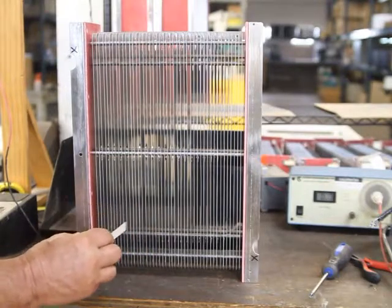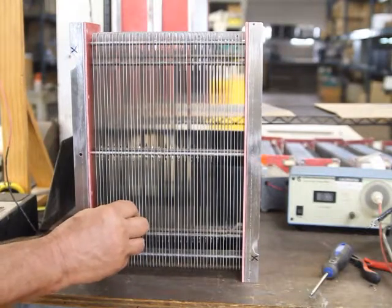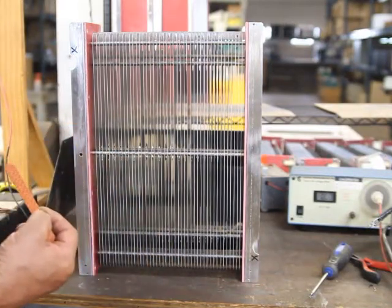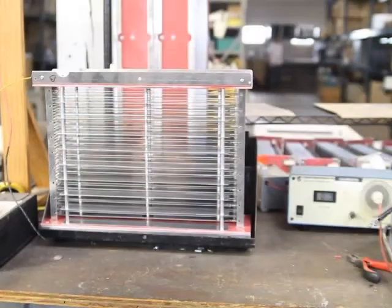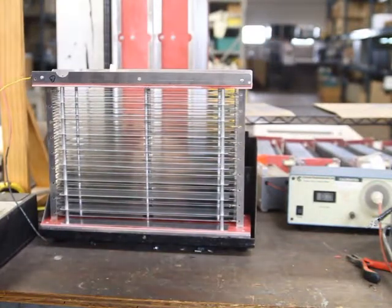We'll do the one before it too. After you've got that done, put it back in and see if the arcing has gone away. You might have to do this more than once because you might not have gotten the right spot. Sometimes you might have to go over twice if it's a particularly nasty deposit — like a bug or something — that's really hard to rub off.